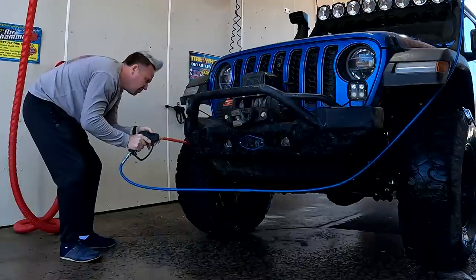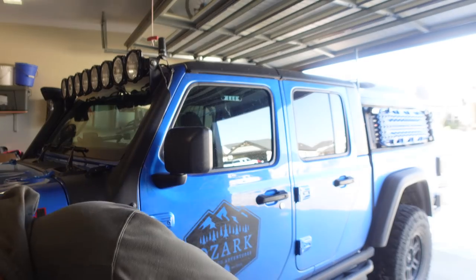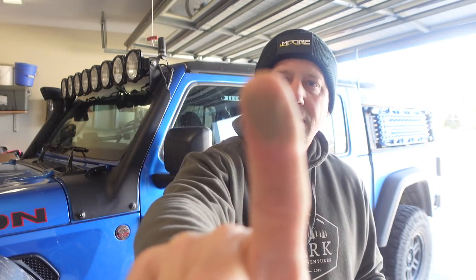I don't use soap for that, but I spend a good amount of time spraying off all the dirt, grit, and grime. There's still some very fine dirt on my wheel here, and if that stuff gets in your bushings and stays there, it will eat away at your suspension components — not next week or maybe even next month, but slowly but surely down the road. If you've got a Jeep with a solid front axle, there's a good chance you'll develop death wobble from worn-out bushings. It'll definitely impact your steering, and wheel hubs packed with mud will wear out a lot faster.